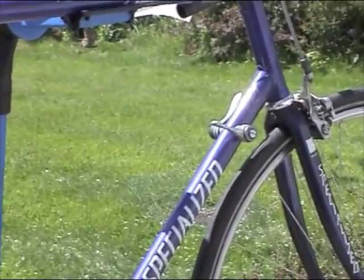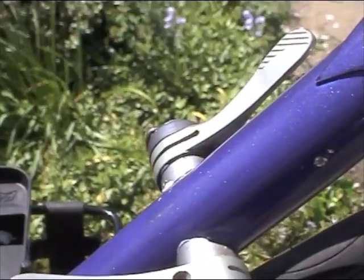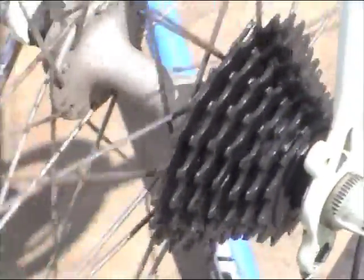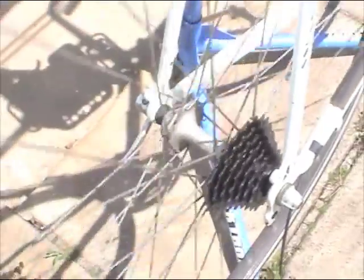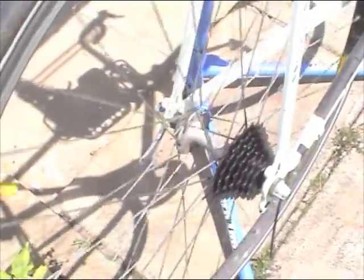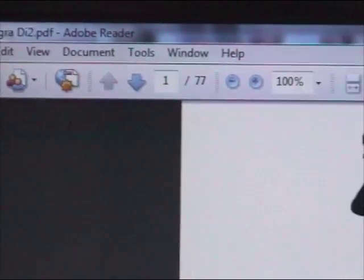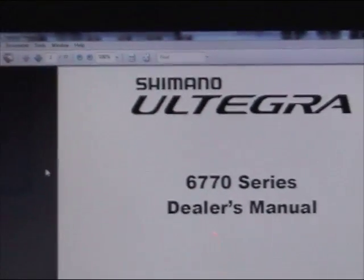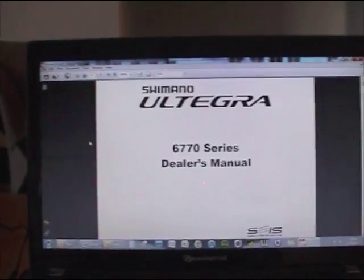The main problem with the bike is the gear lever position, which I wanted to change by upgrading to combined brake gear shift levers on the handlebars. Because it's an old bike, it only has a 7-speed cassette, and combined brake gear shift levers for this number of gears are not so common. Looking for some on the net, I got the idea of upgrading to electronic gears, which would sort out the brake lever gear changing, give me more gears and bring the bike right up to date.